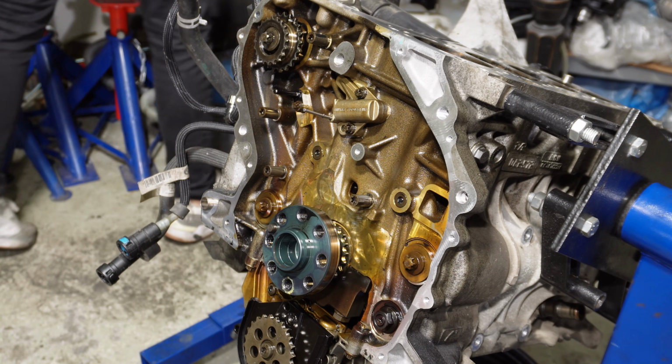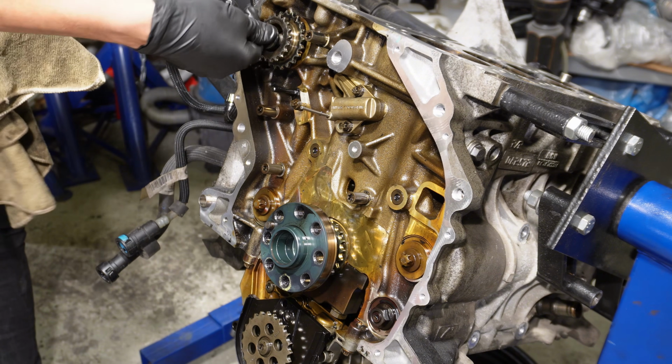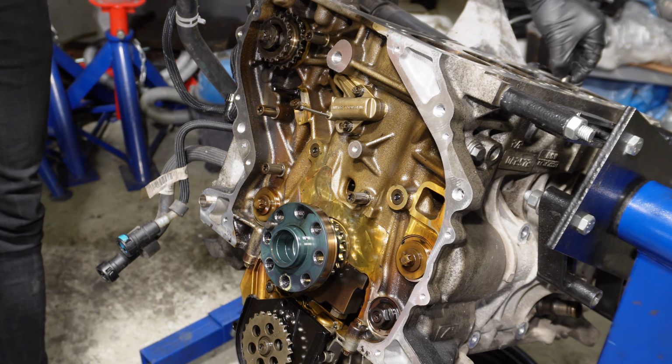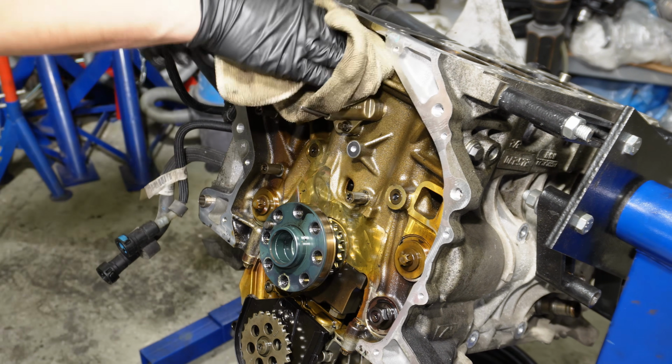So now I still have a little problem. I haven't received the dowel for the head. The engine did have it, but I think when I gave the head to refurbishing, they removed it and they forgot to put it back. Because one of the dowels was stuck in the block and one came out with the head, I didn't even bother to take it out. So now the dowel, I ordered it, supposed to get it tomorrow.